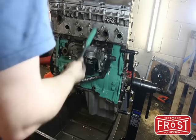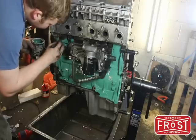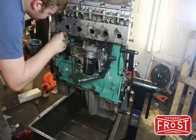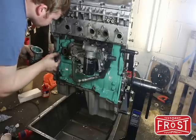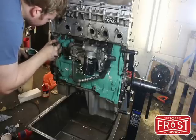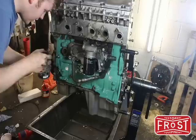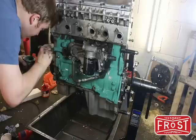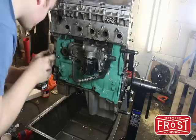I'm using a good quality Harris brush. They're a little bit more money but well worth it because the bristles are better made — they don't come off as you're getting stuck in the paint, and they give you a really nice brush-free finish. I've used them because my dad always used them when he was painting, and my dad used them because my granddad used them — he worked for a paint manufacturer as a sales representative and recommended Harris brushes. You can get them from B&Q; they're not special, but they're just a much nicer brush to work with. When you're doing something like this, why give yourself an extra headache with a cheap brush?